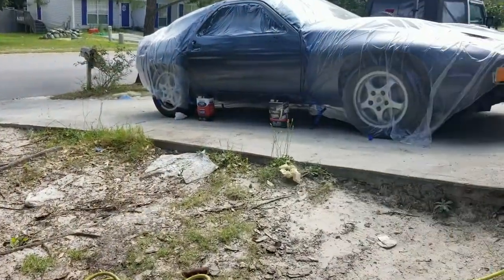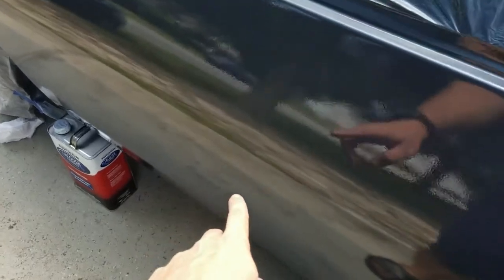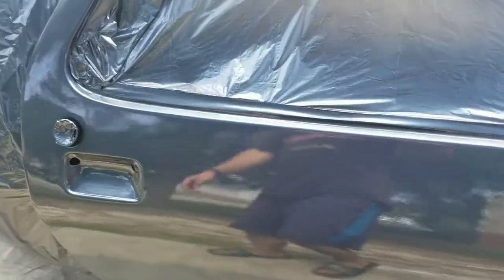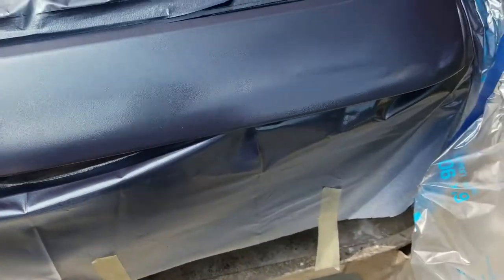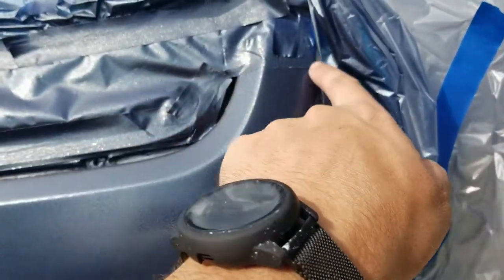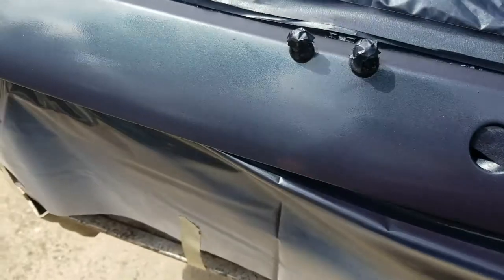I screwed up. I got a bit overzealous sanding and burned through the clear coat and even the paint a bit right on the seam of the door. So I masked it all off and repainted and cleared it too while I did those panels. And then had to do the same thing on the back part of the hatch, because the paint was apparently thin there and got through it on the edge. I didn't do the whole hatch — just masked it there where the spoiler goes across to the edge, so that'll hide the seam there under it.